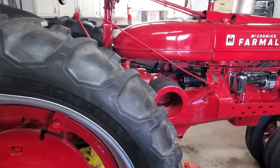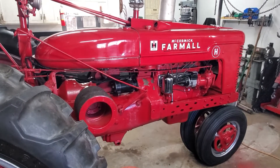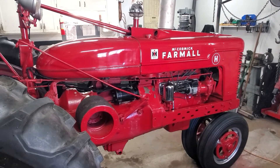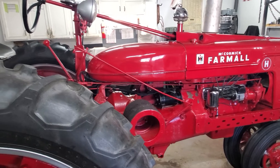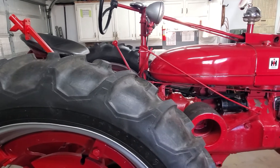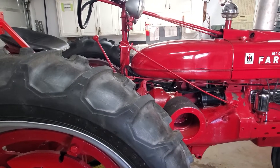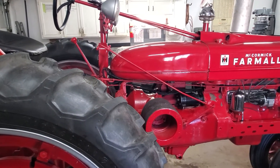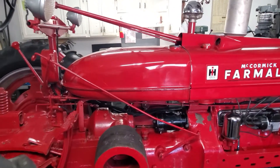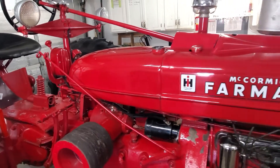The second step was a rinse — in this particular kit it was nothing more than acetone, and you had to rinse twice. Next time I'd just get a can of acetone and do it separately. To dry the tank after the acetone rinse, you cannot put the heat gun in the tank — the heat or sparks from the fan motor inside a tank would make a bomb. So the tank must dry naturally; that's very clear in the instructions. Don't put the heat gun in the tank when there's acetone in there.